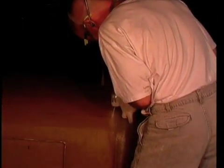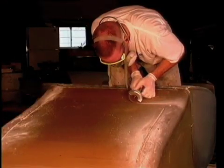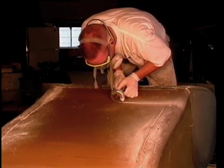Heavy pressure can make the wheel jump offline, so begin lightly and cut straight. Take your time cutting openings in the fiberglass skin. Gouges in the foam can be fixed, but it is extremely difficult to replace miscut fiberglass in areas like trunks and door openings.